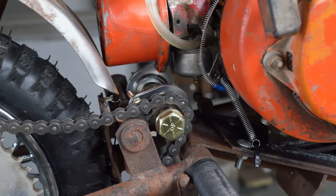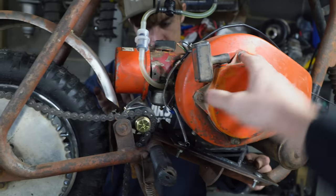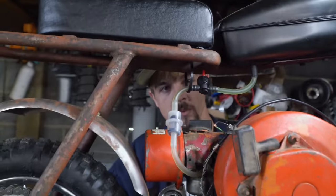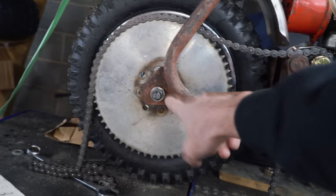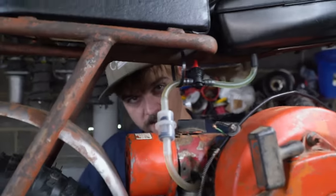So that way we can move the jack shaft independently from the engine, which will tension one of the chains while loosening the other. So we're gonna try to use just one chain tensioner for both chains. If that doesn't work, we're almost gonna have to hog these out a little bit to give us some chain tension in the back, which we don't wanna do.